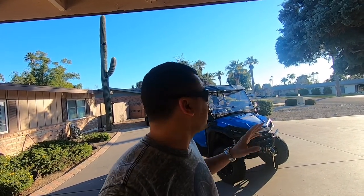So first of all, one thing I talked about in my last video was weight. Weight is your enemy at the dunes. Weight savings is everything. As you can see, I've already put the windshield back on. I took that off because, hey, it makes you more aerodynamic. Your power to weight ratio is key for getting up the hills. And if you ever get out there, you will see the guys with the big turbos or the non-turbo.